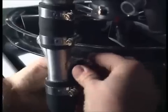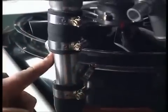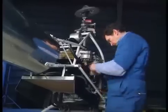The expansion tank goes up here — I know that much. This is the inlet side of the water pump. Next is the bypass pipe from the thermostat housing — we'll do that later. Then this side of the inlet manifold goes up to the expansion tank. Like so. That looks nice. Now, what about some oil pipes?